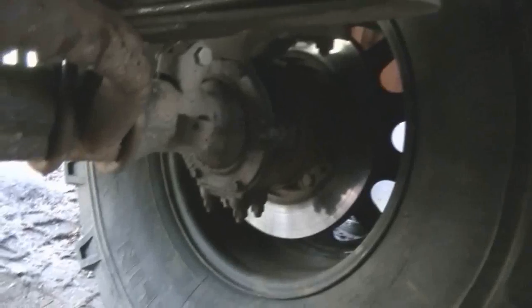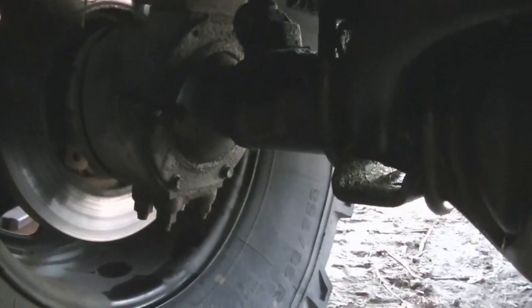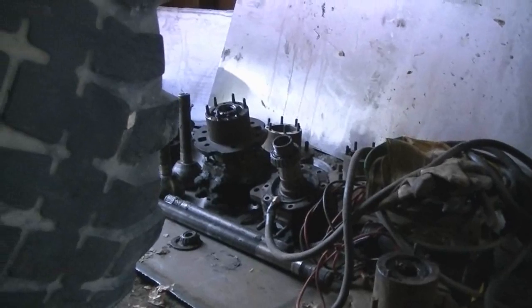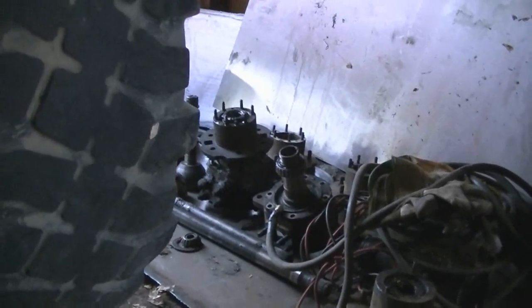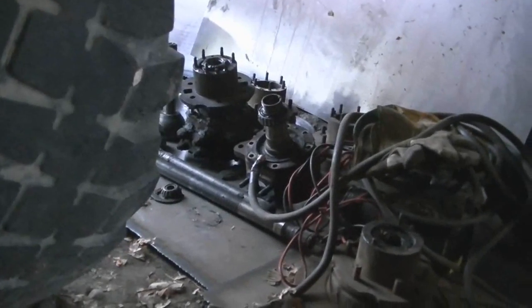My inner seals are still good because there's no weepage coming out of either of the steering knuckles. I've got a busted bolt up top, but I've got two perfectly good steering knuckles right there. I just have to clean the other one up. The only thing is I had to drill a couple of my ear tabs out a bit — not a big deal.